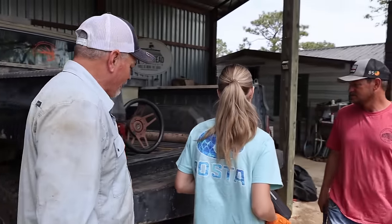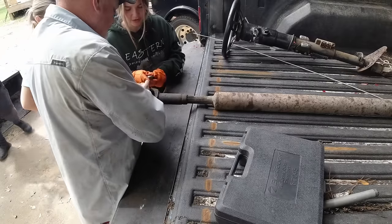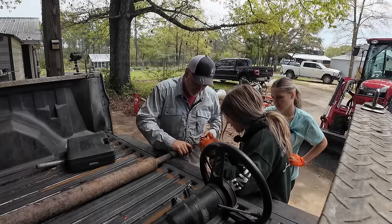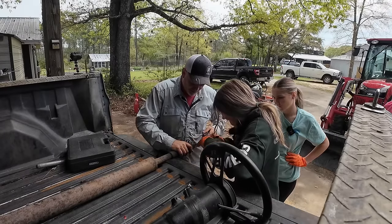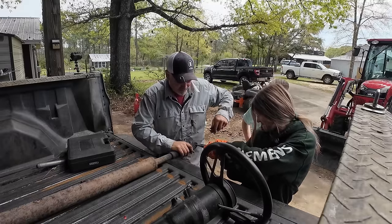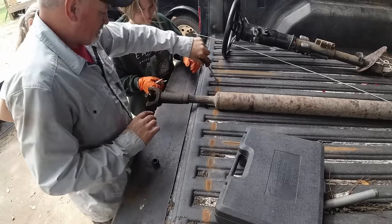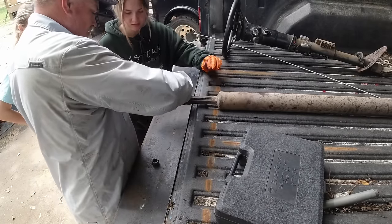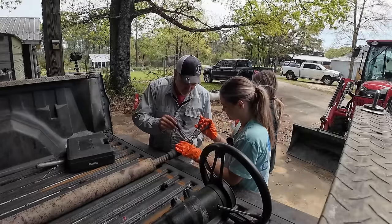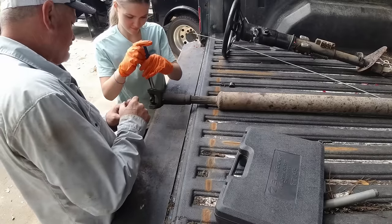Y'all are doing great. Do you want me to try and wiggle that top part out? Yep, keep going. And then your new U-joints will come with. There you go. Yeah. All right. Now we got one more side to do. You want to do this one? Yeah, do this one. So this side and that side. There you go. How do I do that? You're going to squeeze as hard as you can. No, squeeze them together. There you go.